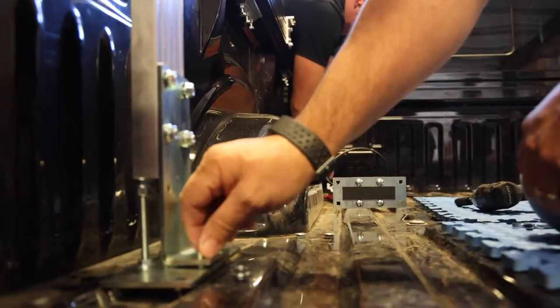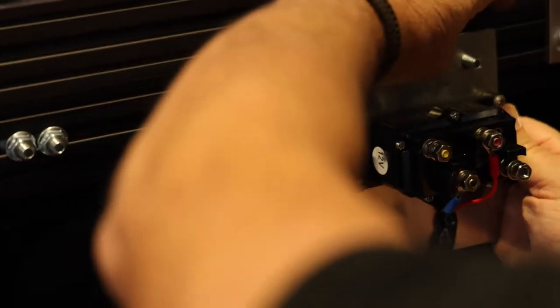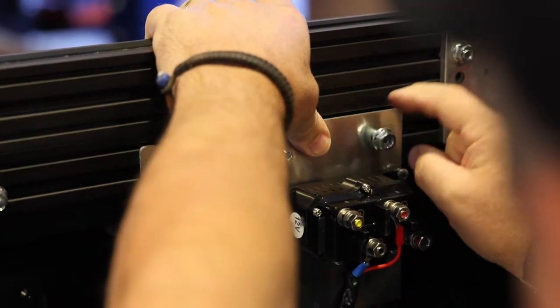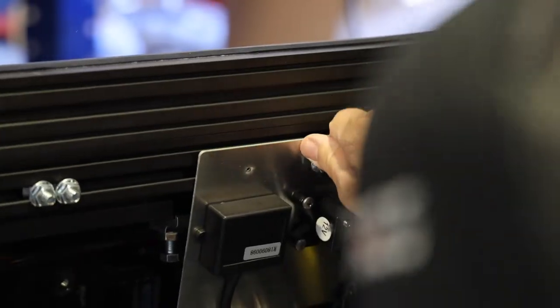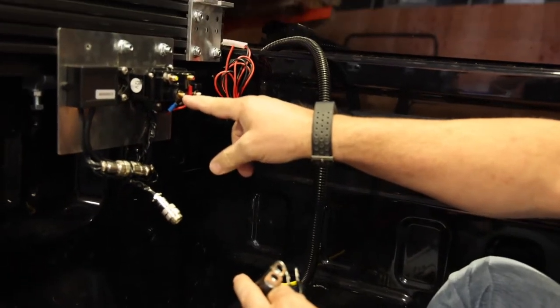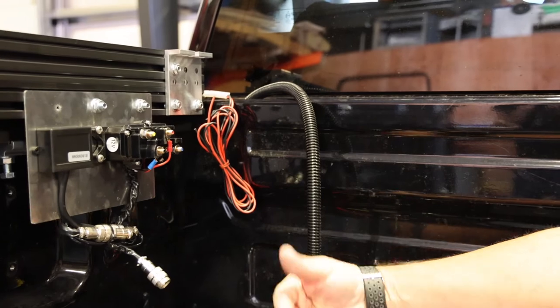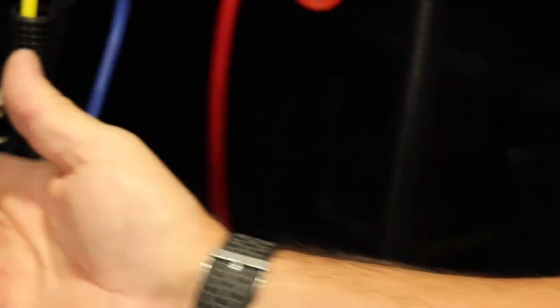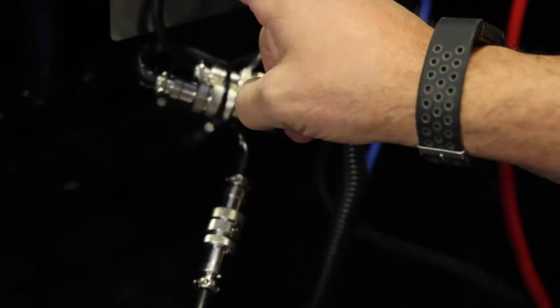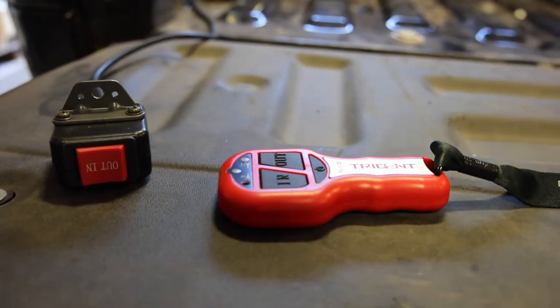Next step, we're going to mount the winch block to the rail. You'll notice your rail came with four bolts and nuts pre-installed. Two of them are going to be for the winch block, and the other two are going to be for your tail legs. On the winch block, you'll have a red and a black wire that goes to the pickup, and a blue and a yellow wire that tells the winch to go in or out. You'll also notice on the block that they are color-coded at the end of the studs. Just match your colors, put the nuts on, and you're done. One wire splits off to the wired winch; the other is the wireless controller on this plate. Everything's pre-installed.